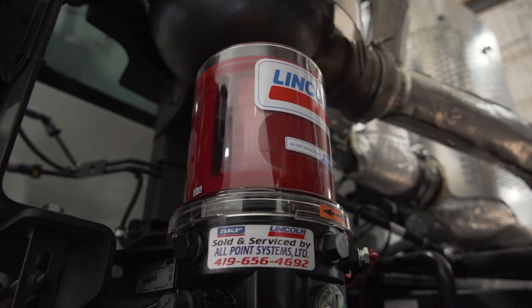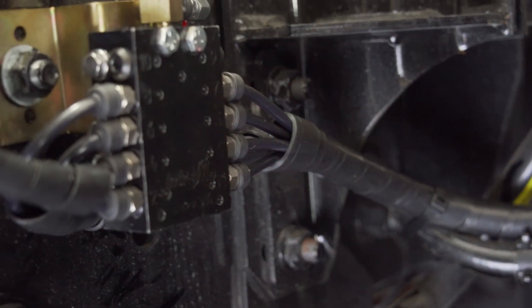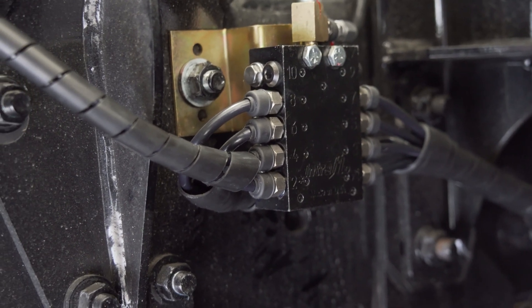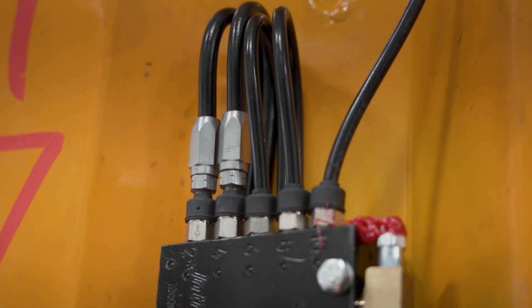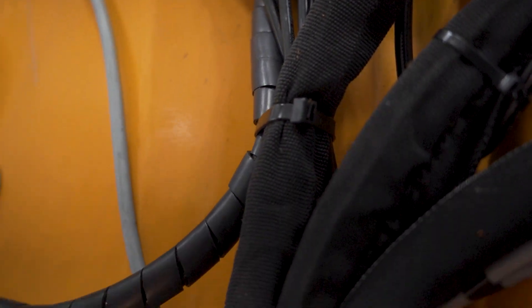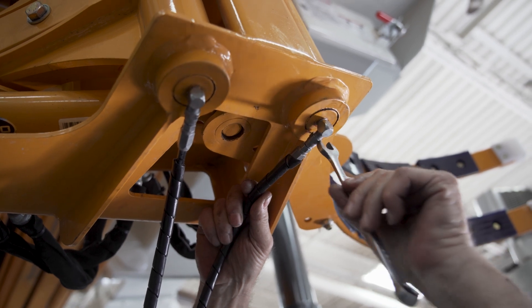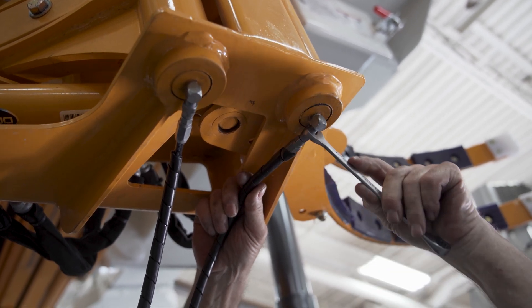The system is set to dispense a certain amount of grease on an hourly basis. Through the blocks, the grease is metered — heavy use and wear items like the front kingpins and the refuse container arm get more grease than lower use items like the tailgate. This metering ensures there is enough grease at each point throughout the system while minimizing waste and mess.